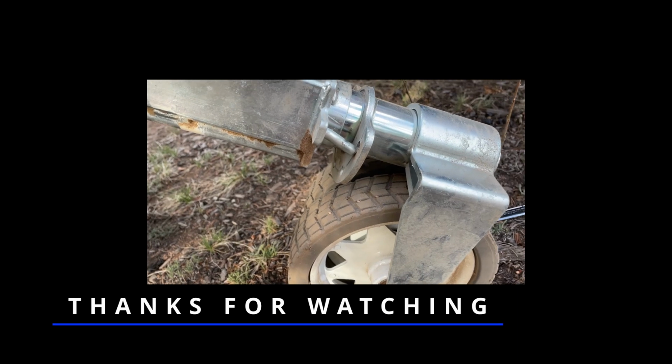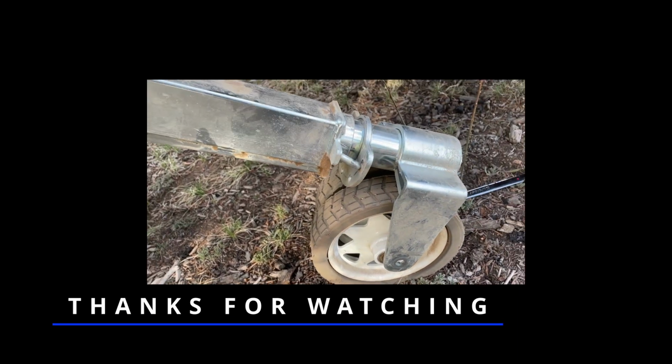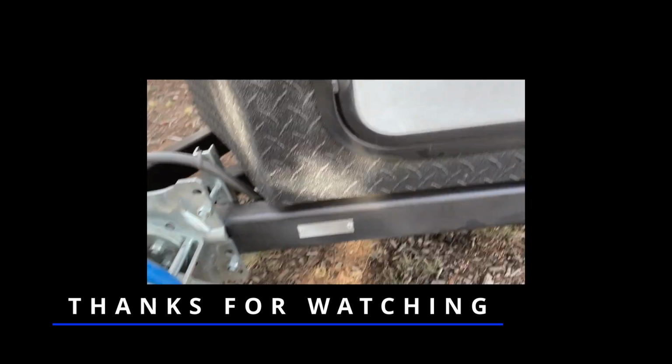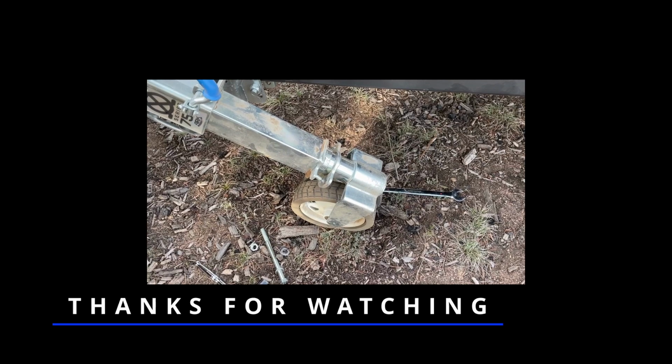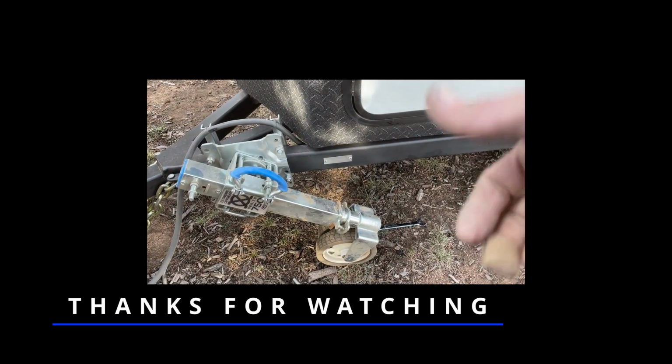Now the alignment came bent because I had the wheel hanging down and it hit the ground. So we're going to flip the axle around so the bolt doesn't hit the side of the trailer. And then I can place the wheels up so we have more clearance.